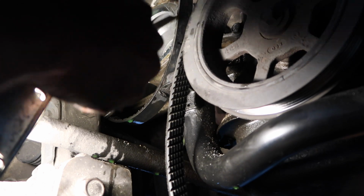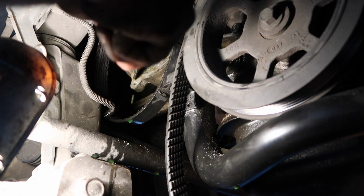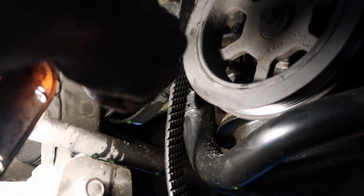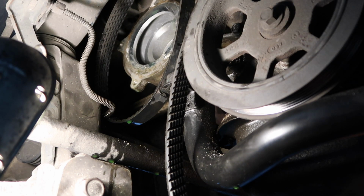It's just scraping it off. If you have some fine sandpaper, you want to use that too, to get it cleaned up even more. But you want to make sure it all comes off of there. Because like I say, if you don't get it off, it will leak again. You don't want that problem. Tear it all back apart again, doing the job all over again. You don't want that. So get that cleaned off.